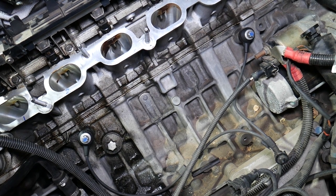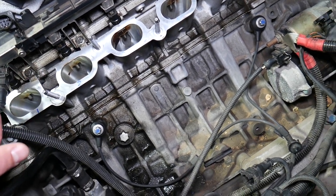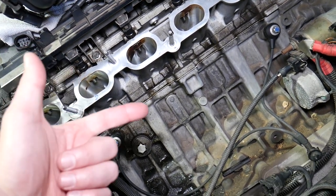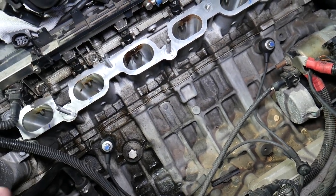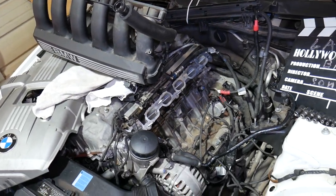You can also hear an engine knock under hard acceleration, especially in a higher gear — like climbing uphill in fourth or fifth gear. To summarize, the top symptoms associated with bad knock sensors are: hesitation, rough idle, jerking, poor fuel economy, and the engine light. Those are the top five signs. Thank you for watching, guys — please subscribe to the channel for more help, and see you next time.